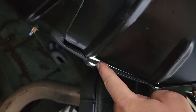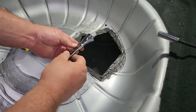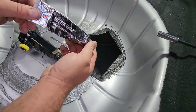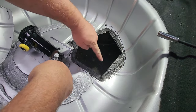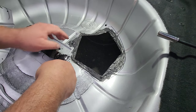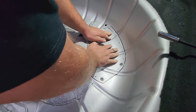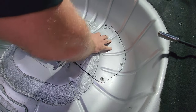I can see a little daylight — looks like I kind of missed. I'll grab my gasket maker and use just about a whole tube of this stuff. I'll leave a link in the description so you guys can keep some on stock too. Smooth out a nice thick layer and splotch on the cover — it'll seal really good and I'll zip it with self-tappers. Primary goal is to create a seal. I'm not welding it closed so I'll still have access, which is great. Seal is primary, access is secondary, and I think I'll be able to achieve both.